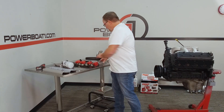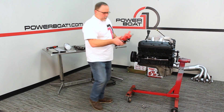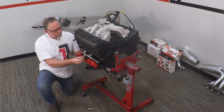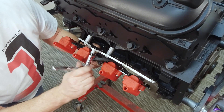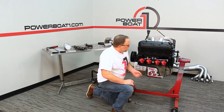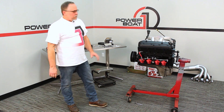We made a nice little bracket here out of aluminum that's just going to bolt right onto the side of the block using the top old motor mount holes. Then we take the coil bracket — we've got some little spacers here that we tap — so we'll put the bolt in through there, put the little half inch spacer on, and just run it up into that hole like that, then go through and tighten all those down and that'll hold it tight. Our wiring harness is going to come in from the back underneath and plug right in here so it'll be able to fire all the coils from our LS MSD control box. Then our plug wires — nice little MSD wires — they're just going to pop on to the coils and right on to the plug, and you've got a nice clean look. All this will be down under the headers.